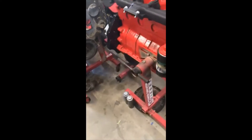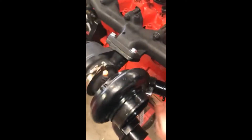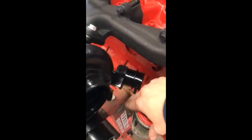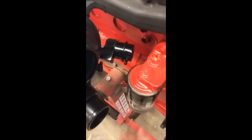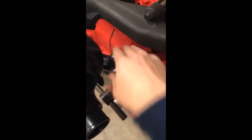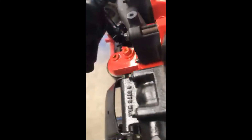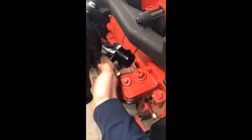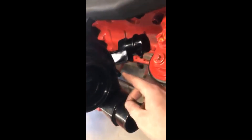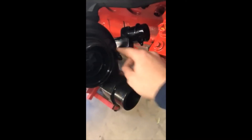Let's get this thing mounted up on this motor so you can see how it looks. Here it is bolted up — loosely for now, but this is basically how it will be in the truck. You can see plenty of room to get your oil filter down there. On a 2nd gen truck with the automatic there is a line right in this area, but this is going in a manual so I'm not going to worry about it. I usually just mount this as close as I can to the cover with it still having a gap. Just a little short rubber hose from there to there.